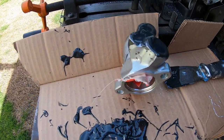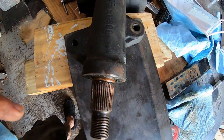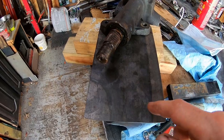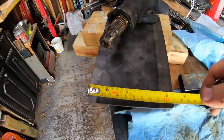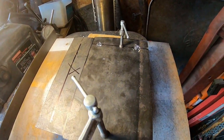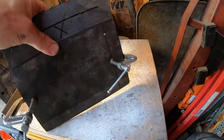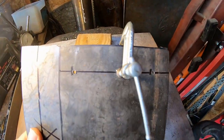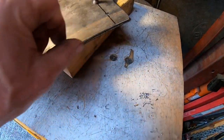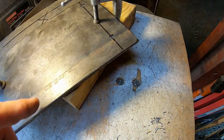Put a little epoxy in the holes on both sides — that should work. I'm cutting out a plate from the new crossmember, using the power steering box to get the holes correct. It's about 85 millimeters apart, five inches long — this will drop the crossmember down. The hardest part of fabrication is making two things exactly the same. I clamped the first piece of steel, marked a line, drilled two holes through both, and got one good factory cut edge to use as the front of the brackets.